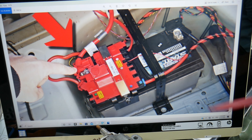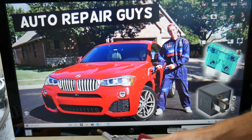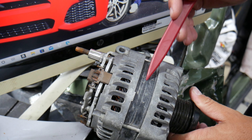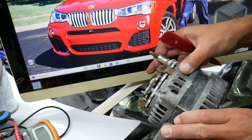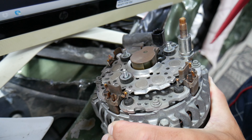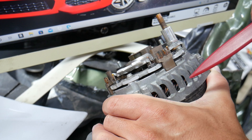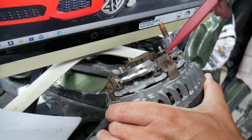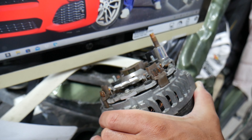Also check your battery sensor and make sure it's good. Something we see often that most people ignore: the alternator right here is driven by the serpentine belt and charges the battery. When you start or jump-start your vehicle, it charges the battery — everything works fine. But sometimes you may notice lights flickering slightly. On the back side of the alternator, you have six diodes. These diodes convert electricity from AC to DC, and it's a one-directional process — from the alternator through the big cable to the car battery.